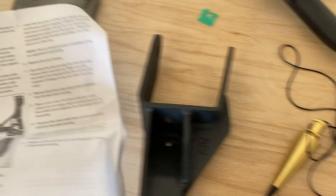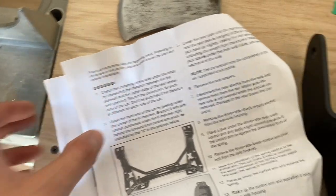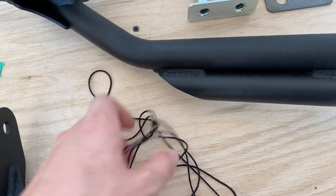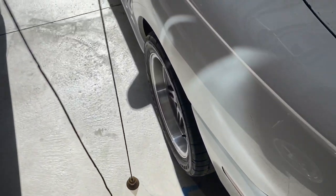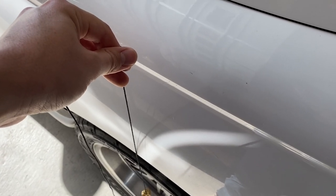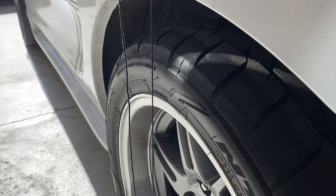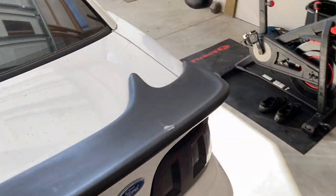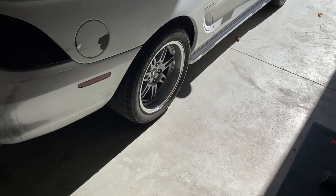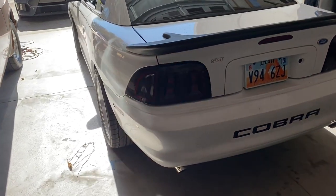Right off the bat, when you get the instructions, they're going to talk about Step 1: check the centering of the axle under the body by measuring the distance between the tire sidewall and the upper edge of the rear wheel well opening. What they mean by that is get yourself a plumb bob — you could make one out of some heavy washers, you don't need to buy them. You're going to hang this down from the side of the fender, wait for it to stop moving, then pull a measurement to the wheel. Take the same measurement on the other side — those are your baseline readings. Don't be surprised if the axle is off-center, but you'll be able to fix that with the panhard bar.